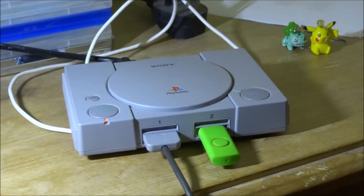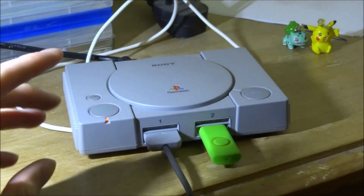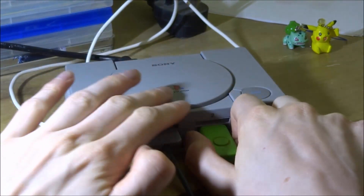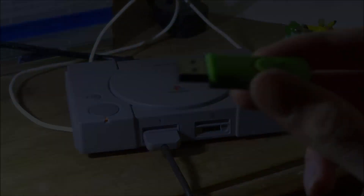The next section is creating the kernel backup — again, just wait for this part. You will then get a screen saying the setup is complete; wait five seconds and it will restart. After that, your TV screen should be black and you'll just have the orange LED. Don't touch it and don't press the power button — go ahead and take out your USB and plug it back into your computer.